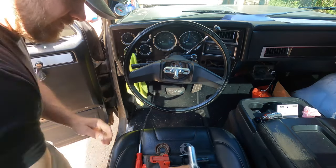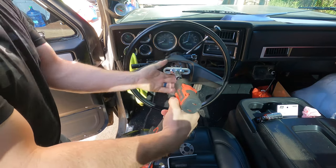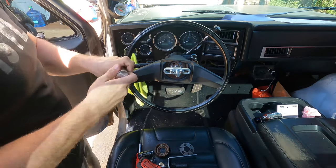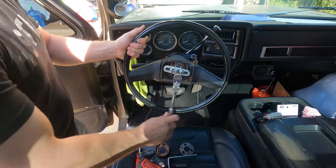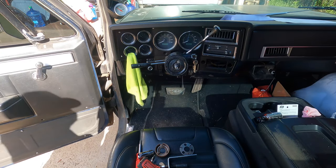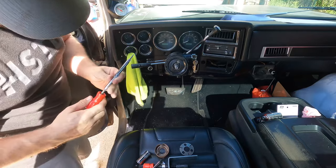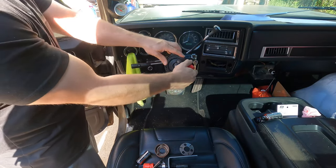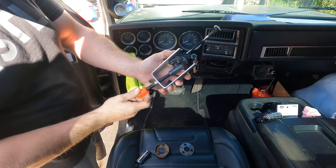Speed the process up a little bit, then go back to the actual socket so you don't break anything. The steering wheel is locked so it should be pretty easy to come off - you're just gonna slowly start to turn it until it pulls it off the splines. Once you get the steering wheel off, you're gonna have a little plastic cover for the lock plate, so you should be able to just take a flathead screwdriver and go around the edges prying it up. I've had to fix a couple things already and replace the bearings.